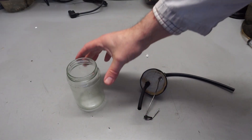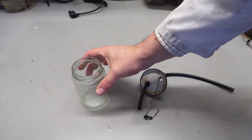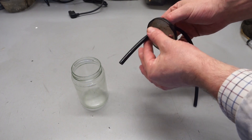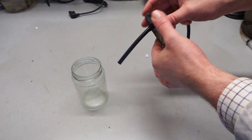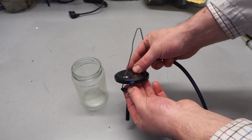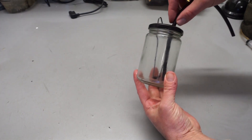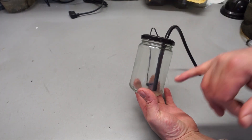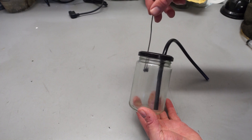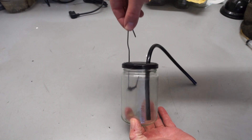I have made my own collection pot to catch the fluid as it's bleeding out of the brake lines. Basically it's just a jam jar with a metal lid — I've punched a hole through the lid and put a pipe through it with a little bit of tape to hold it in place. On the other side I've put a little metal wire through with a hook on the end to hold it up. I like to have the tube all the way to the bottom so as soon as you start bleeding it's in the fluid and you won't get air sucked back into the pipe. The hook is just to hang it over onto a part of the car's bodywork while we do the bleeding process.